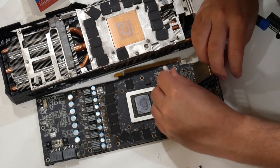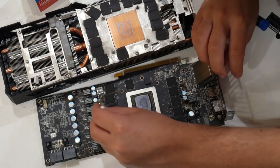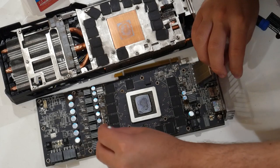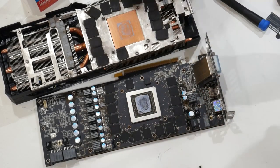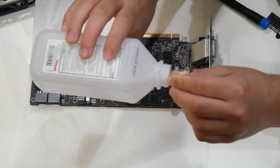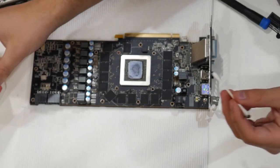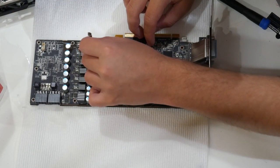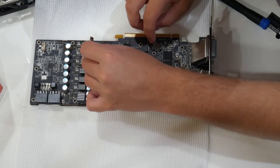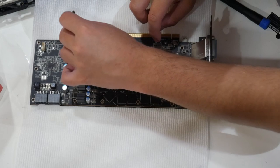As you can see, I've opened up the card — unscrewed all the backplate screws, the four retention screws that keep the copper cold plate on the GPU, and the one screw near the display ports required to remove the entire cooler assembly. We're now left with the bare PCB with all the components on it.